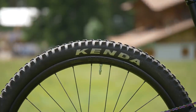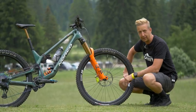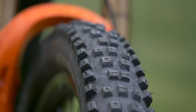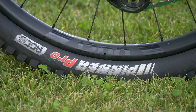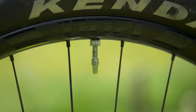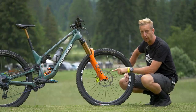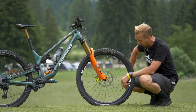The tires are an interesting thing. Not too familiar with the Kenda tires — don't see them quite as much, but they're certainly making their mark in the world of enduro riding and racing. These are the Hellcat Pros. No insert in the front, but setup tubeless, running a CushCore insert in the rear — but not running the downhill one, actually running the cross-country one. A little bit slimmer, a bit easier to get on and off should you damage a wheel or tire in the event of a race.